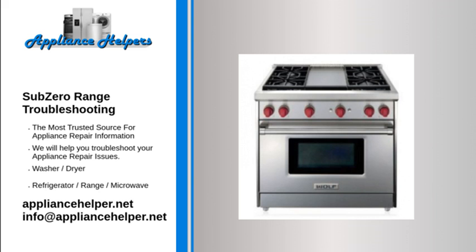OPP displayed on the oven control knob: one of the ovens may be in self-clean mode. If one oven is in self-clean, the other cannot be used. OE, OC, or other error displayed: contact Wolf factory certified service.